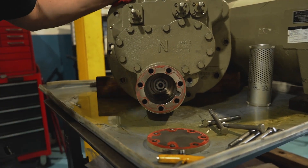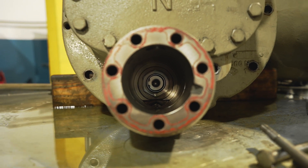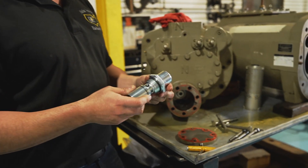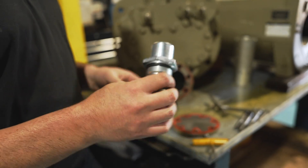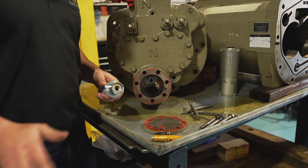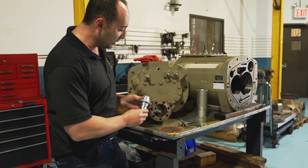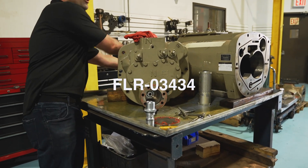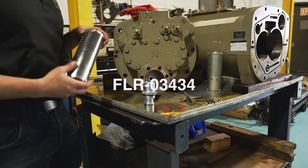If you look all the way back there you'll see a little metal cylinder — that is this valve, the oil cartridge lock valve. This is what it looks like if you took it out; it's screwed in the back. If you're just changing the oil filter, you do not need to change it. It's good to take a look at it so you know what's back there, and that's what the new oil filter slides onto.